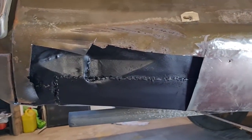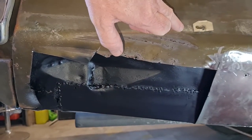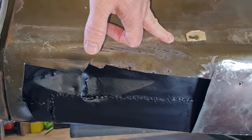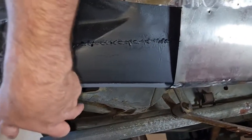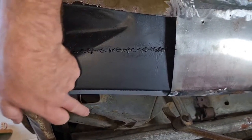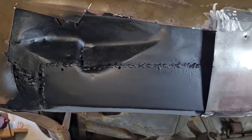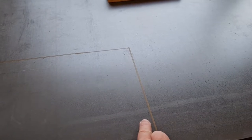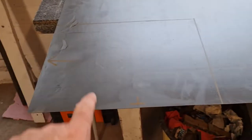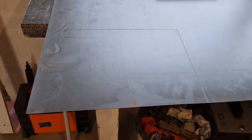I've had a measure - we've got 13 inches by, including the lip, about 10 to 10 and a half inches. I don't mind having a bit extra down there. That's weldable primer and then I put the undercoat on - obviously when that bit tucks under again I need to plug weld, so I need weldable primer on that. So I've measured it out: 13 by 10. Right, let's get on and cut this out.